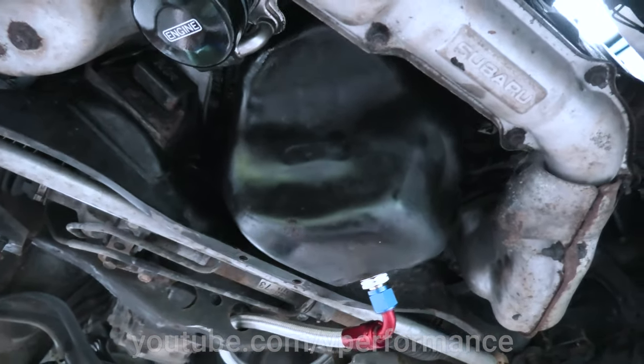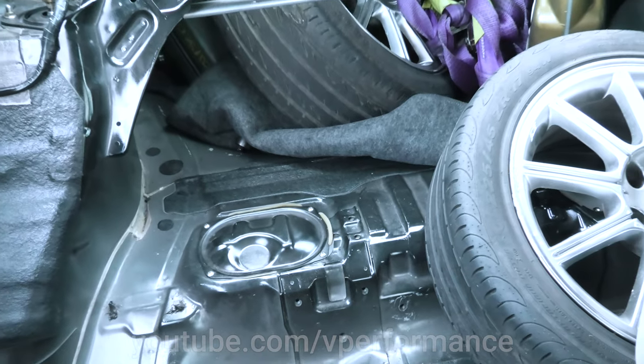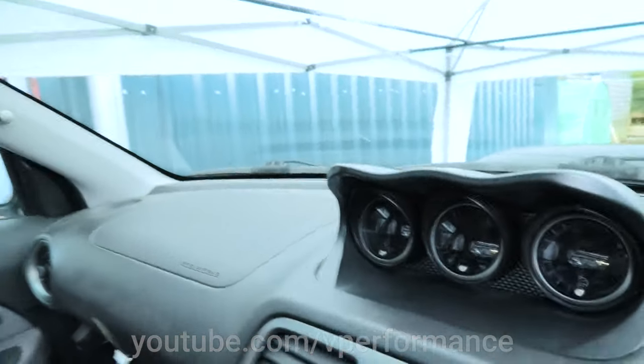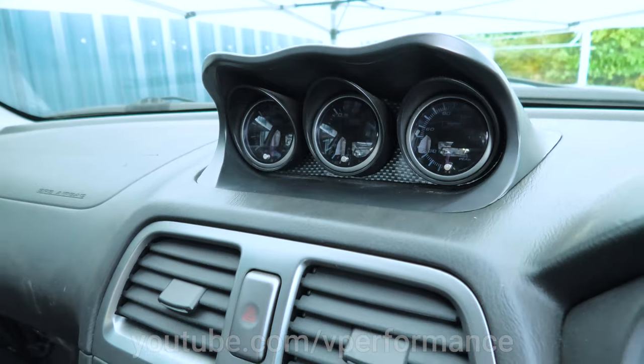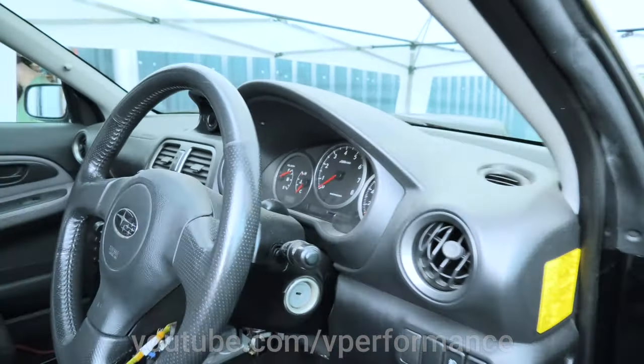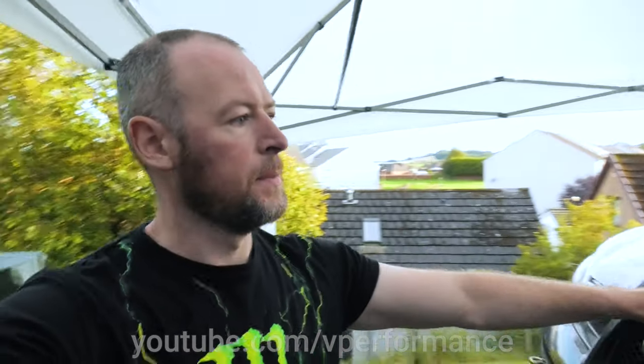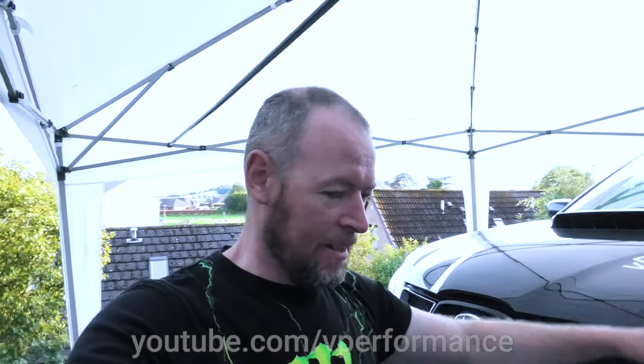Something baffled back in place, we just need to put oil in it. Not that you can tell the difference, but we've now swapped onto the big possibly 850 horsepower fuel pump. Our gauges are in and they're wired in a respectable manner — soldering and spade connectors, no twisty twisty nonsense like it was when we got it. This has been the single most tiring day that we've had of Subaru work. Many of the tasks that we tried to do didn't go to plan, but we got the big stuff done. Baffled sump on, pickup pipes done, lots of the wire routing taken care of, fuel pump for 850 horsepower, catch can — catch can was a pain in the balls.